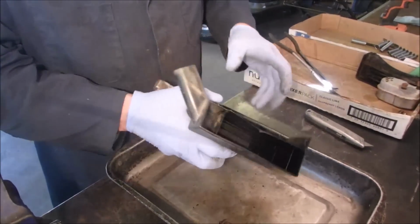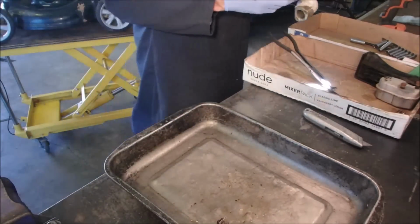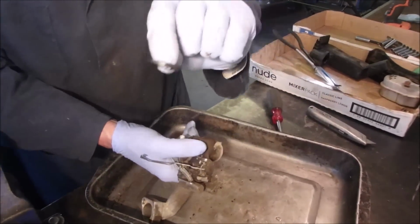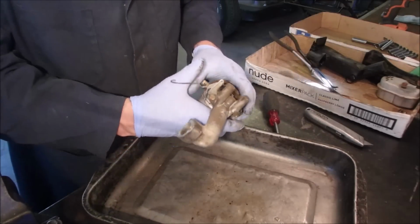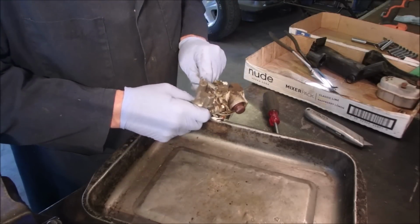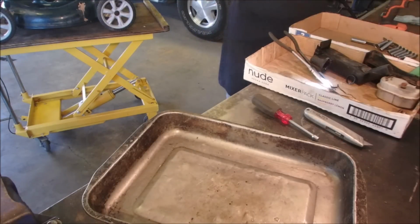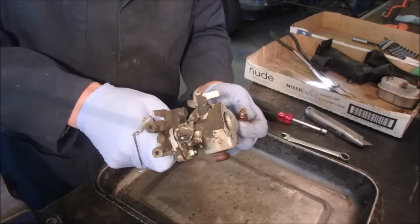Good. Okay, now we're going to need a 1/4-inch nut driver to get this off of here. That's just no fun to have on there at all. You guys remember that video? Got sucked right into this end here. Okay, so now I'm gonna take off that throttle control. Might leave this one dangling. And a 1/2-inch nut driver. Or if I could talk, I would have been a salesman. Okay, 1/2-inch bolt out of here, 1/2-inch bolt, nut, and jet all at the same time.